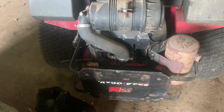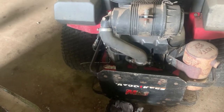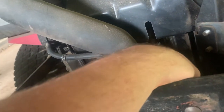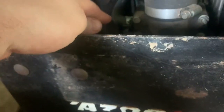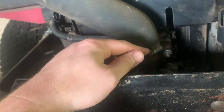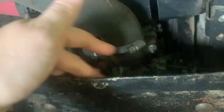We're gonna clean out this carburetor. What you're gonna need to do is there's four bolts, and of course your linkage on both sides. You're gonna have a fuel inlet over here that has to be undone. Then your crankcase vent right here and your air intake tube right here. Take these off real quick and then we'll slide the carburetor off and hopefully it'll clear right here.